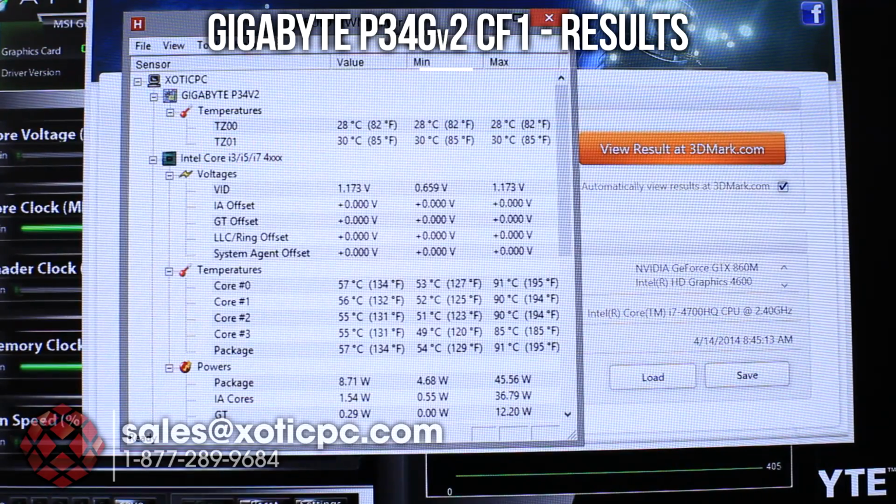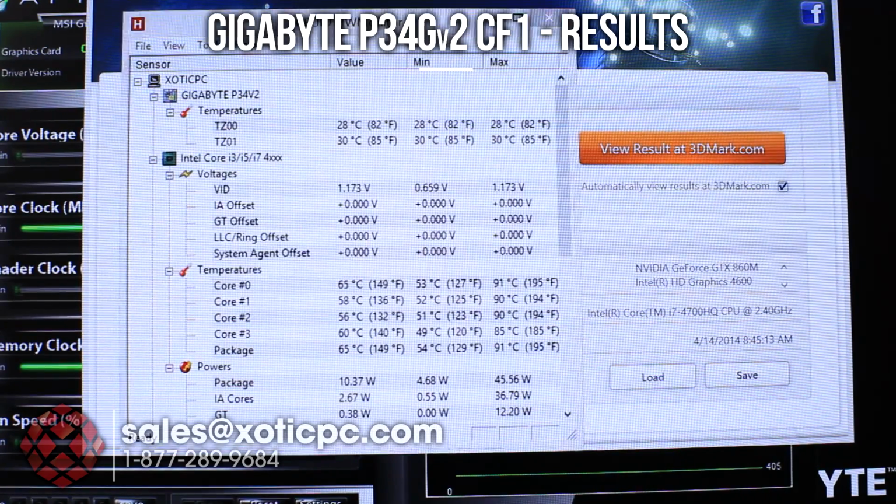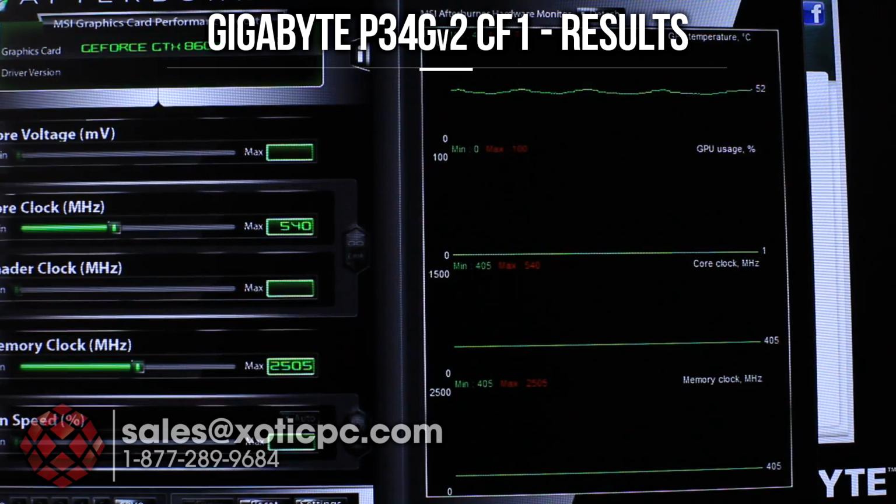You'll see the CPUs did get kind of high here. We're looking at pretty much average about 90 Celsius all the way through. For some reason, HW Monitor did not pick up the graphics card, but I also did have MSI Afterburner running here. Might be kind of small, but very nice temperatures here. Minimum 46, max 74. So 74 max during a benchmark program or stress test program.